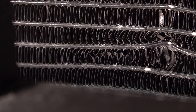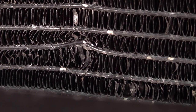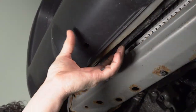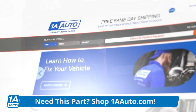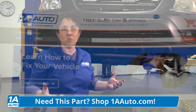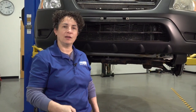They didn't tie it in with the accident, because why would they? They're not automotive technicians. They're just thinking, yeah, insurance took care of it. But you have one year to reopen this with your insurance and let them pay for it — make sure it gets done correctly. Always make sure you look underneath to see the true story. If it's been years since the accident, or maybe you just bought a car like this and don't want to spend much money, you can do it yourself very easily at 1AAuto.com. We sell thousands of applications for these condensers for cars or trucks, and step-by-step videos. You just have to go to your local shop, get your AC recycled out and evacuated, then do the repair, bring it back, have them vacuum it and fill it up with AC, and down the road you go.